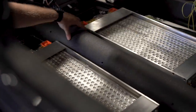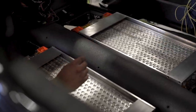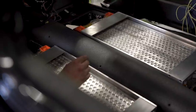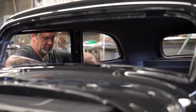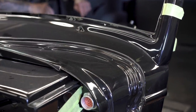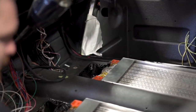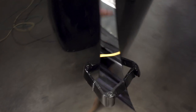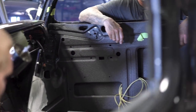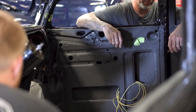I had it going here and then up and then finishing here because I was going to put the box and all that stuff on this side, so we just come straight out and go to the distribution bar and then to each controller. The only thing I could think of for space was making that like a hidden wall to run our dash-six dash-eight main lines inside of the trans tunnel — up inside there, maybe three-quarters of an inch, just big enough. That was the only place I could see, because you really can't get anything in this area — I tried before on both sides.